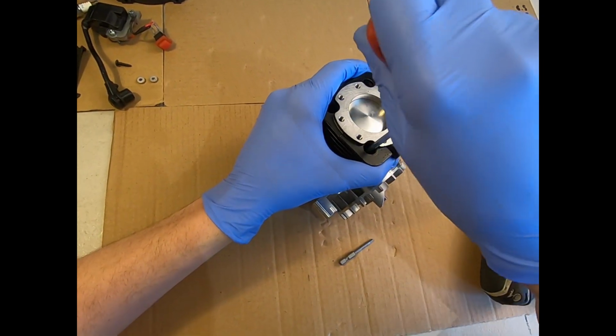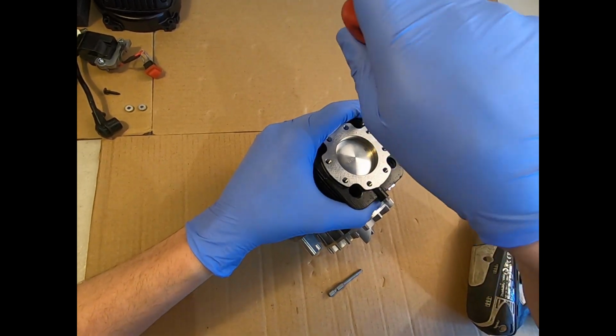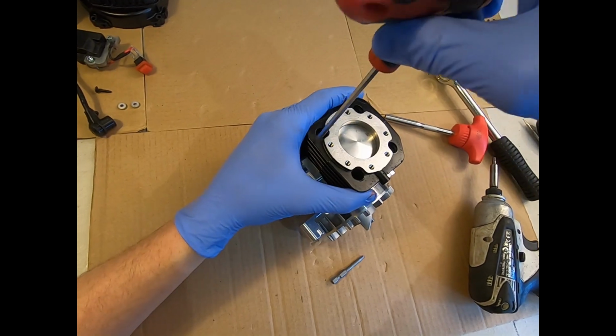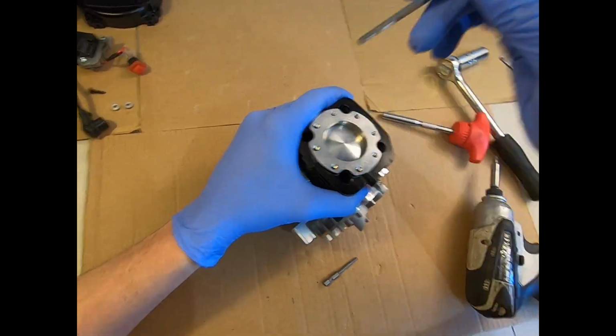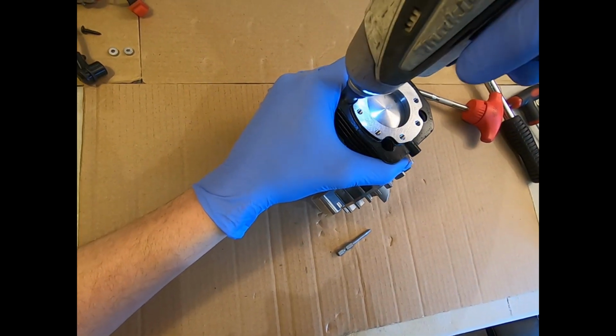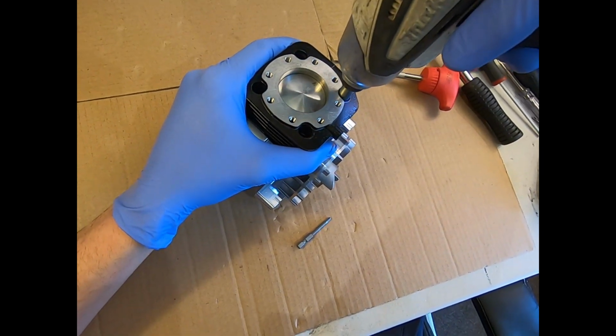These main 4 cylinder bolts here will be a little bit tighter, and they have a longer, deeper thread, so a bit more winding out. They're an M5/20 socket cap, and they should be tightened to 8.5 Newton meters. Let's just whip down in here. Now I've got them loosened up. Get in there with my gun and cheat a little bit for speed.